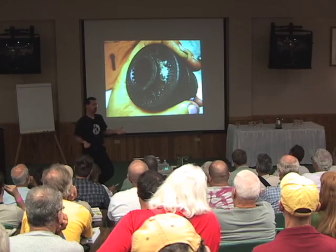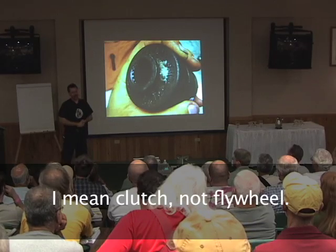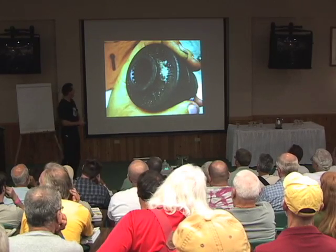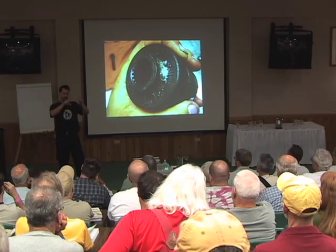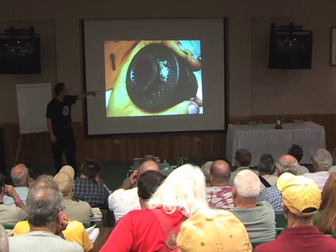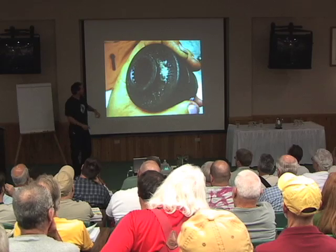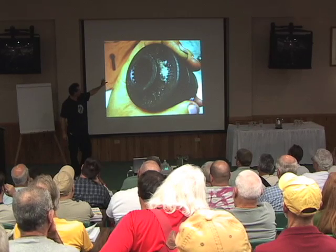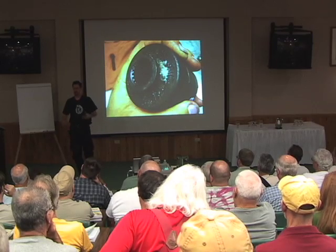Since the car originally had a clutch, a flywheel is kind of an abrasive spinning disc, and in the middle it has splines — flutes. What I did was I took the old clutch plate, ground down the four rivets that held all that abrasive material onto the middle metal part, cut that down, and then those splines match up with the shaft on the transmission. Then we took just that little middle piece and welded it into a Lovejoy coupler.